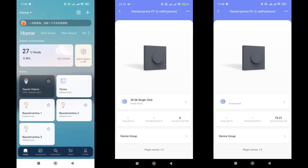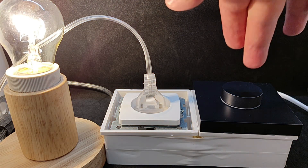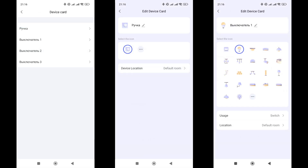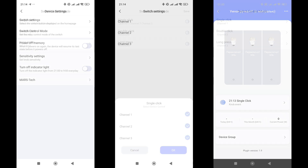Object Control Panel. The review device is displayed as four cards, but the plugin for all of them is the same. It resembles the switch plugin, but without the graphical display of each relay channel. At the bottom of the screen is the energy monitoring panel — it is common and counts by input. By default, pressing the button turns all three relays on and off at once. In the device card menu, you can change the appearance of all cards — the dimmer and each of the switches. The most interesting menu is the settings, which starts with a parameter to display selected relay channels on the main plugin screen, making it almost indistinguishable from the switch plugin.